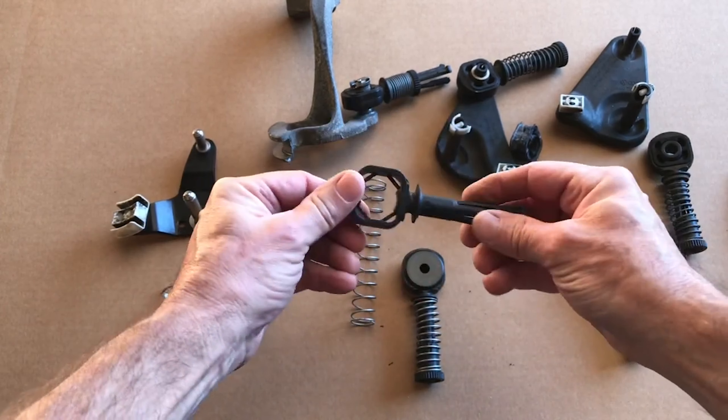Go one more thread out, then check again. If you have a helper, they can be in the car pushing over to the wall and going into first. That was nice and smooth — the bell crank is actually kicking up a little bit now. It really is a product of the slop baked into these MQB boxes — the plastic boxes are not great — but that's about as good as it's going to get with the stock cabin linkage. At this point we've got all our gears and can get them smoothly and easily.